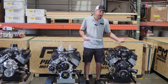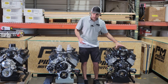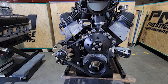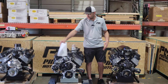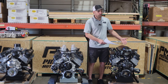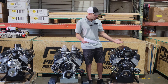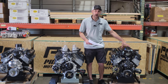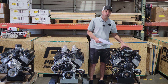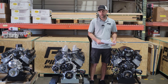Obviously, this has taken that 575 base and brought it up based on induction. These pulley kits are very similar to each other, minus the slight under- and overdrive difference. So it's almost fair to say: take 15 away with the pulleys — that would have been around 560 — and then the CNC manifold brought it back up to 610. That says a lot about what this manifold, along with our CNC program, can offer to the final output of the engine.